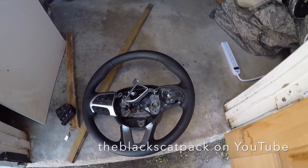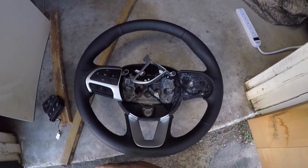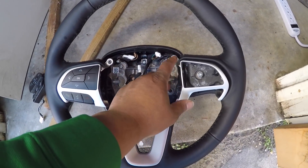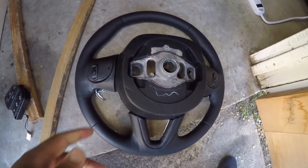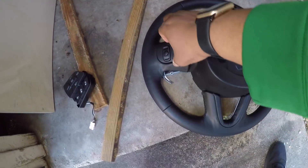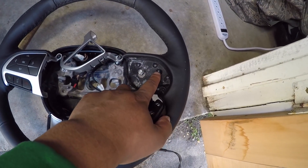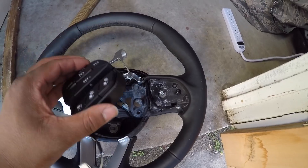If you're not subscribed to the Black Scat Pack channel, make sure you do so. This is his old steering wheel that he took out of his Challenger — he swapped it out with the actual Hellcat flat-bottom steering wheel. Once we got the cover out, you can see this silver accessory piece — there's a T20 bit you're going to take out to loosen it. Then go in the back. His doesn't have paddle shifters, so you want to take out this little housing with a T15 bit to get the paddle shifter off on my steering wheel. Then once you take that off, there's going to be another bit you have to take out to get the actual housing out — you're not going to get it from the front, you're going to get it from the back. Once you're able to get that, you can take the accessory out along with the housing and get everything swapped out.